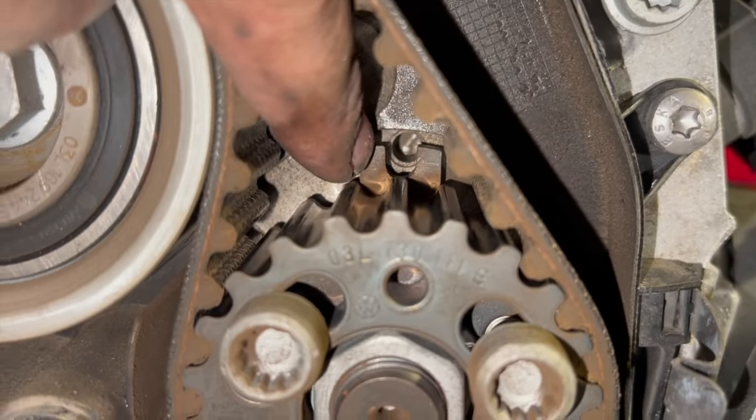That's all. Obviously once it's in, it's solid, and you can just take your spanner off, so don't try and turn it too hard. But you'll know, because obviously it's adjustable. Once it is locked, you can't turn it on the centre bolt there. Same with the fuel pump, just give that a light tap, but you can just see, now that it's lined up, the pin just slides in and out of there. Once it's in there, that's locked to the actual fuel pump pulley as well. And you can just turn the sprocket to the right-hand side setting there.